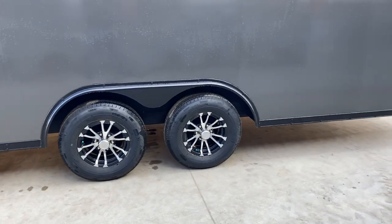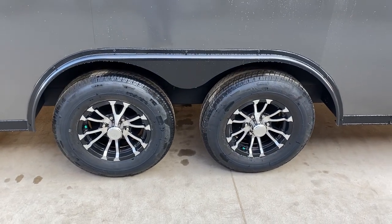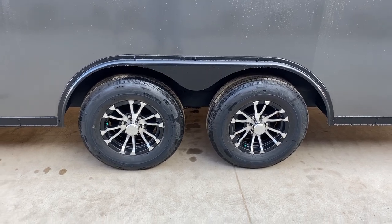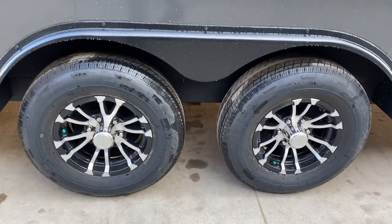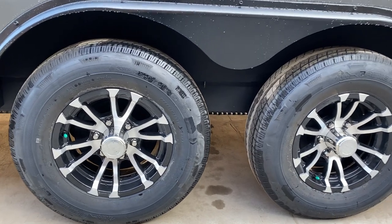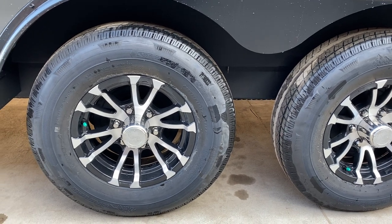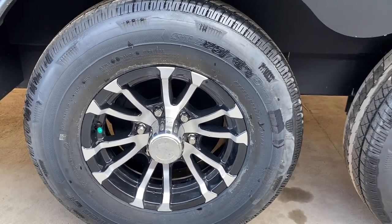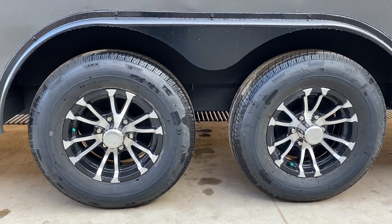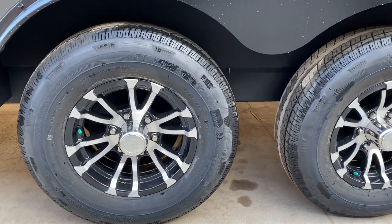All your trims are blacked out, including your fenderettes. Short Track normally does aluminum wheels, but this is a black inlay wheel used specifically on these Blackout trailers. All Short Tracks we do with 5,200-pound axles, which is going to be a six-lug — six on five-and-a-half pattern. Your aluminum wheel comes with a 225/75R15 tire, which is a load range D eight-ply radial. You'll also see the nitrogen-filled cap — this tire is filled with nitrogen, which is drier and helps keep the tire from dry rotting from the inside out, without the moisture you'd get from a traditional air compressor.